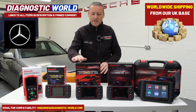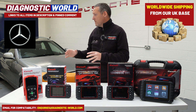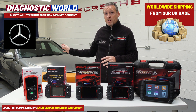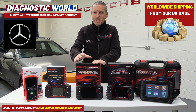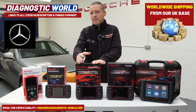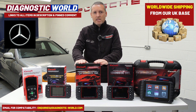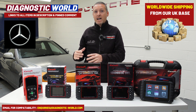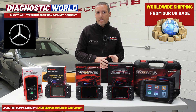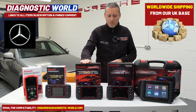Vehicle coverage is also worth mentioning. Even though we're only talking about the C204 in this video, this tool covers a lot more vehicles. In fact, if you have a Mercedes-Benz generally from around 2013–2014 onwards, this allows you to interrogate the ECU and find out the genuine mileage of the vehicle — so it lets you see whether the vehicle has been clocked or the mileage has been put back at any point. That's a really useful feature of the MB version 3.0.